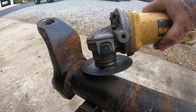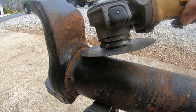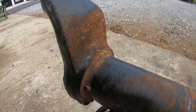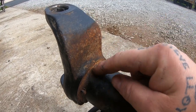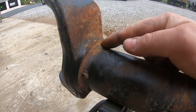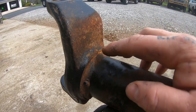We're gonna come in at about that. We're gonna come up about halfway on the weld bed. This is all just reference for general ideas and general attack angle. And we're gonna start about right there, and we're gonna gouge out a little spot. We're not gonna attack it full bore and go all the way into the meat just yet. We're gonna attack just a small portion, get some of that weld bed out of there, then we're gonna work our entire way around the axle tube and get some of this extra weld surface out of the way before we really attack in there.